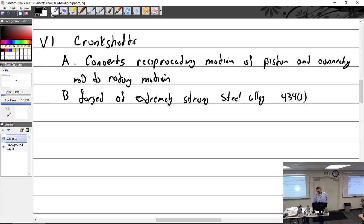The steel alloy is 4340. Lycoming crankshafts are heated to 1,200 degrees Fahrenheit for 24 hours and then checked for runout. Any crankshafts that are bent are placed under a hydraulic ram while still hot and pressed within two minutes of removal from the oven. So they heat them up incredibly hot and you can bend them — that's how they straighten them. They're forged, very rough-looking, and then machined down. They are then nitride hardened.